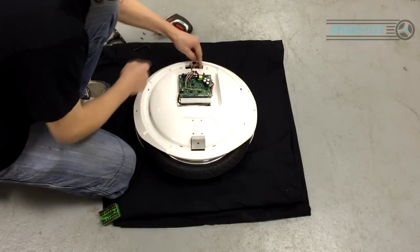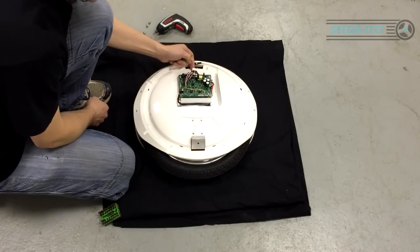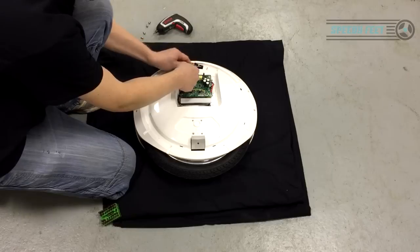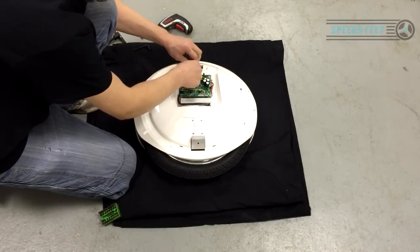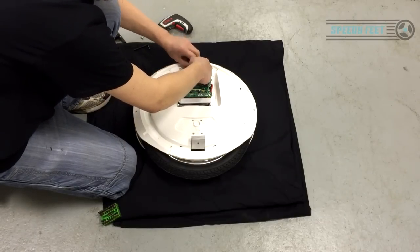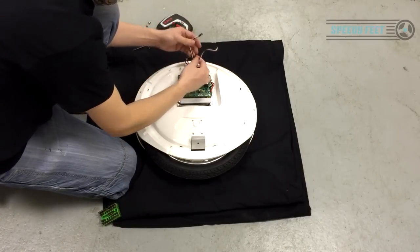So what you've got here is an overlap piece of plastic. Don't pull that up too much. It's designed to have a little bit of movement to allow you to move the wires. When you're moving the wires, gently, always the same, just gently. Never force anything. Nothing on this unit needs to be forced or should be forced. You just pull those wires out very, very gently, and remember where they were before you started messing around with them.